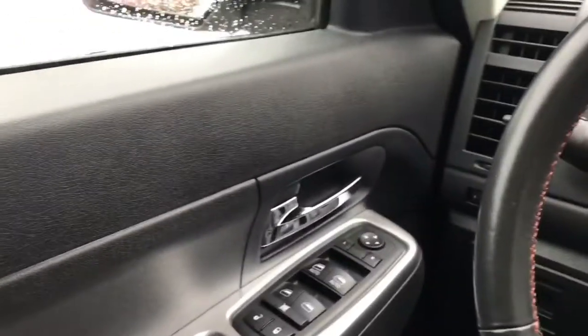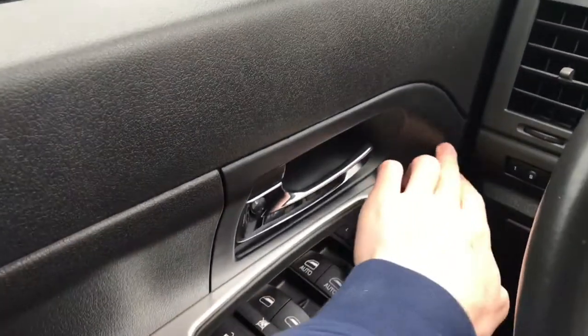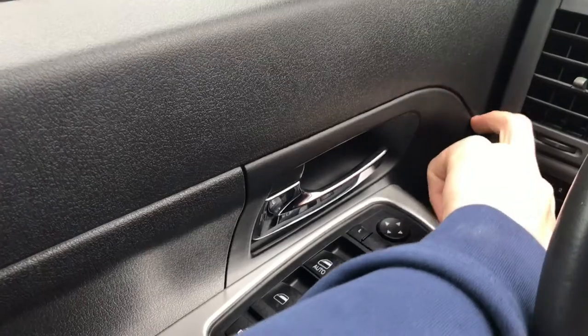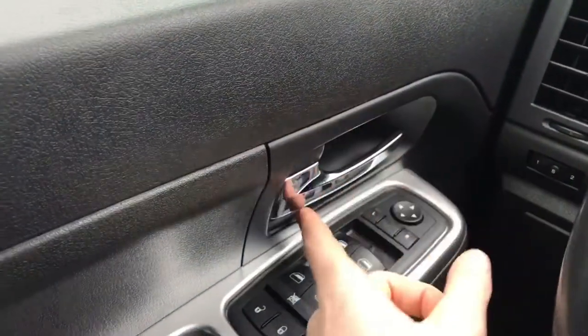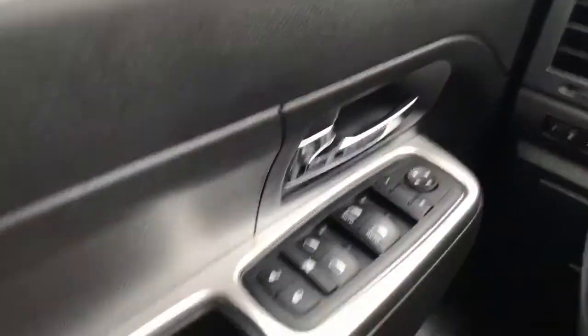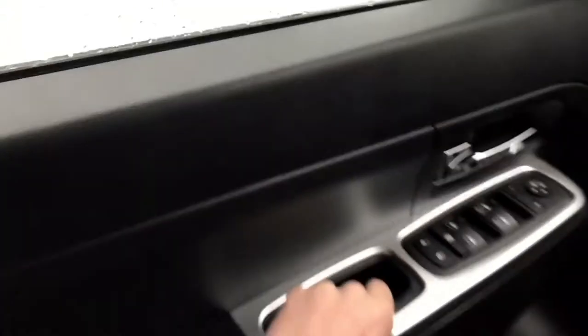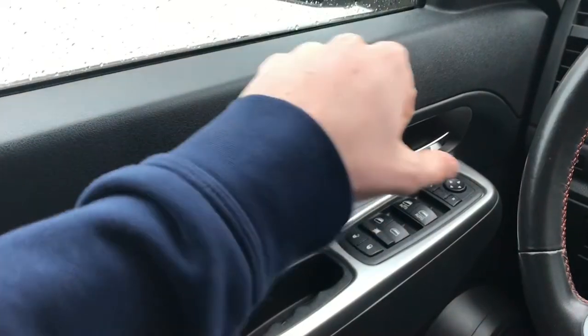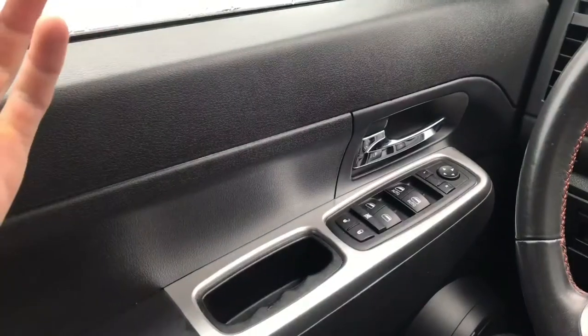For the doors — I mocked them up before in the earlier clips — you want to pop off the panel that goes around the door handle, and it just slides out from inside of this. There's a 10mm bolt up here, and then down at the very bottom of the door there's a clip with the screw in it. Take that out, then lift the door panel up and then out. Remember to disconnect the wires before you pull it off, and once it's off you should be fine.